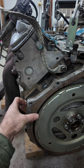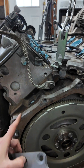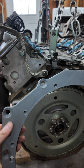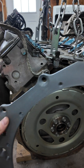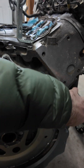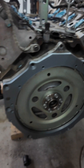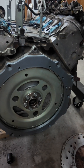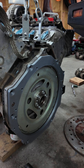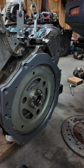I think we should go with a full inch of space before we go down to the Rover bell housing size. So a one-inch engine spacer then our adapter plate — or maybe the entire spacer plus adapter plate will end up getting milled out of inch-and-a-half billet aluminum. Either way, we need that amount of space: one inch from the engine, then we can go down to the Rover bell housing opening, and the Rover bell housing will mount to those points. For precision — especially so the dowel pin holes are a precise fit — the adapter plate will have to be CNC machined out of aluminum. I think that's the best way to do it.